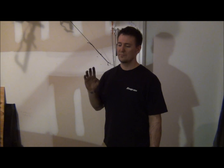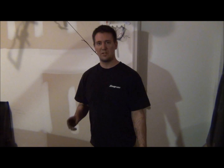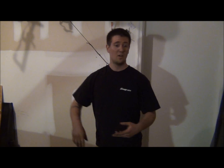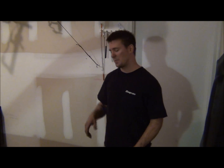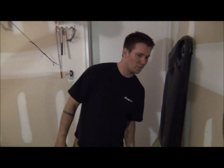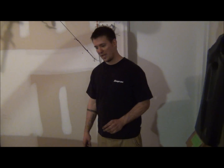Now, a couple thoughts about the crank pulley. The crank pulley on any car is usually a pain, especially if you don't have air tools, or if you don't have an air tool with enough power, or your air compressor doesn't push enough PSI to even run the air tool properly. That thing's a 26 gallon or something like that. It just doesn't push enough, even with my 1/2-inch Snap-on impact, to get it out.